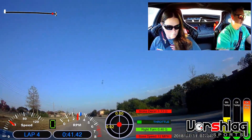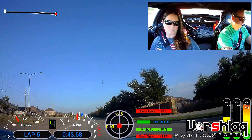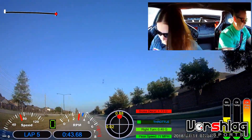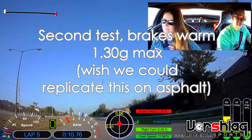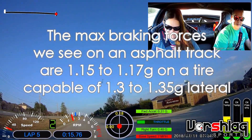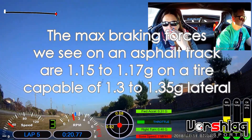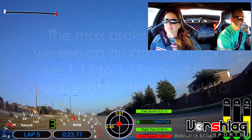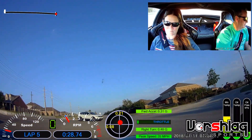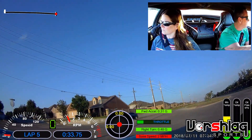AO52 tires. And we went a little bit further than this. The problem is it's only braking at 1.15 G. And on these tires, they'll lateral at 1.3, 1.35. And 1.15 just ain't enough. We're giving up a ton of time on brakes, and this data should prove that.